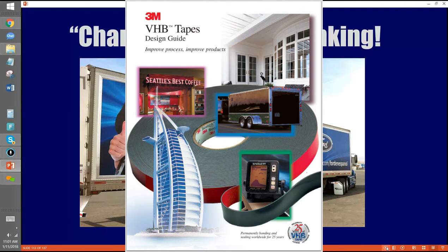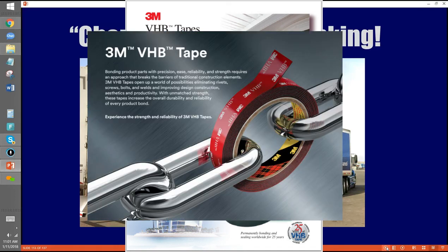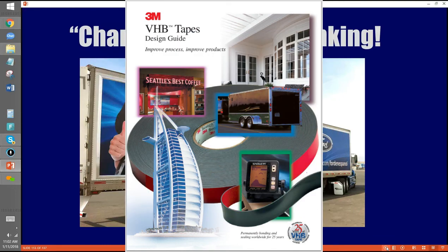What about refrigerated trucks where you don't want to poke holes in them? We sometimes pre-apply VHB to the back of the frame. VHB is the closest thing to epoxy glue in tape form — you can literally peel and stick the frames without any fasteners penetrating the wall of the truck. It cuts installation time, costs about $200 to $300 per semi-trailer, but you probably save that in labor. If you ever want to remove it, there's a 3M solution for that. We actually blew 3M off for two years when they first proposed this because it didn't seem right, but then we tested it on local trucks and it holds extremely well.